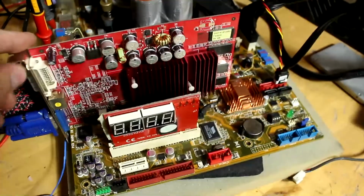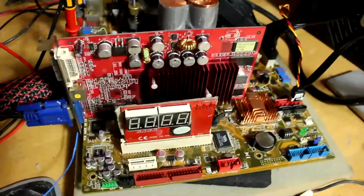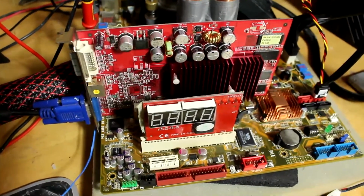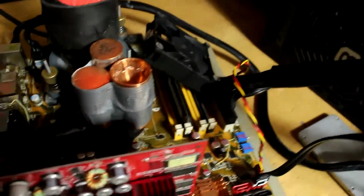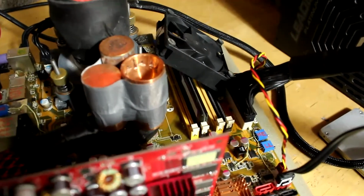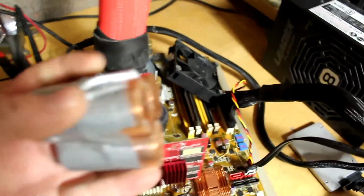Now this is a PCI GeForce FX 5200. I use PCI because on some boards it definitely helps with FSB. I have yet to properly test it on P35, but it's definitely not gonna be worse than a PCIe GPU. Postcode card, single stick of Corsair XMS2. Those are D9 GMH based. I managed to get over 740 valid out of this stick, so it should be fine for maximum FSB runs.